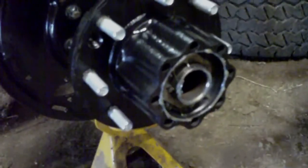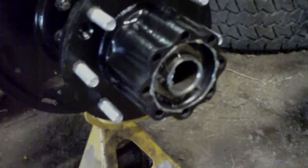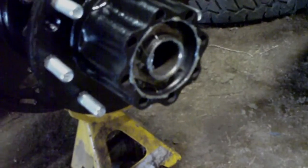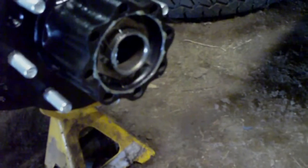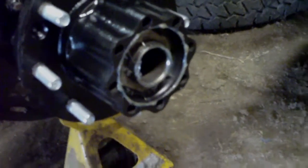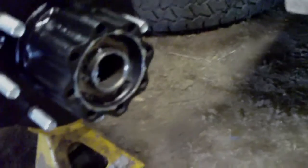I thought I'd do a quick blurb on reinstalling the hubs on the axle. I've got the seals and the inner bearing in, as well as the adjustment nut. Apparently there's a couple of different setups — one has a keyway to retain the nut, mine happens to be one with a lock washer between two nuts. The basic procedure for setting up the rear axle correctly is pretty simple: tighten the adjustment nut to 50 foot-pounds while rotating it.